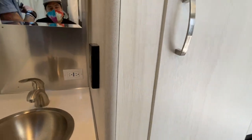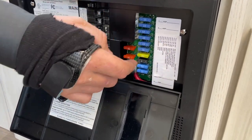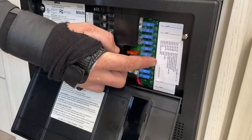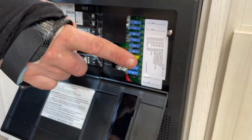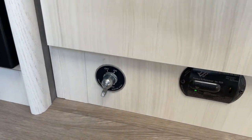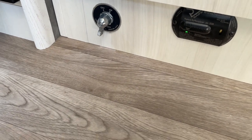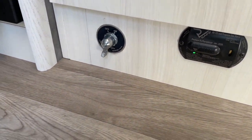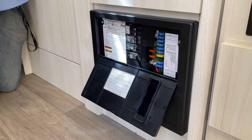You've got your microwave just like at home. Now for hot water — this is your control panel for hot water. You can set it up to 124 degrees. Now this panel here — think of it like your car's 12-volt system. It gives you a diagram of everything: your bed, ceiling fan, bath lights are all hooked up to this. At the bottom there are spare outlets. This is your LP detector — if someone turns on the stove with no flame going, that alarm will go crazy. If propane is accidentally left on, that alarm warns everyone there's a gas leak, so you check the stove first.